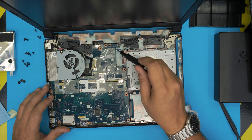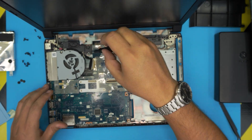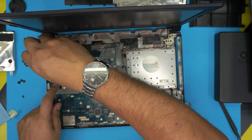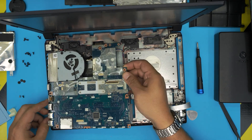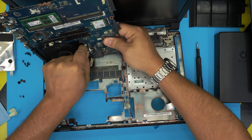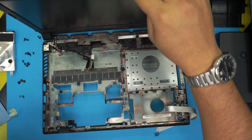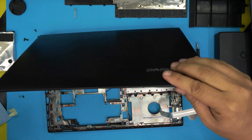Now we're going to remove the motherboard. Remove the screw by the battery, then remove the screw on the fan side and left of the motherboard. Bring it out, rotate, and unhook the power jack from the bottom — just slide it out. You can pull the cables fairly firmly, those are tough cables. Once done, you can see the inside — go ahead and clean it up if it's dusty, this one is a little bit dusty.